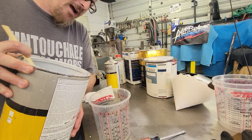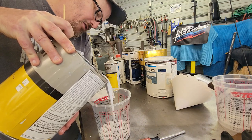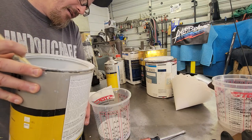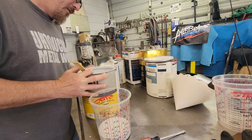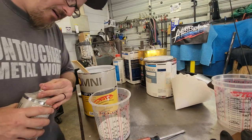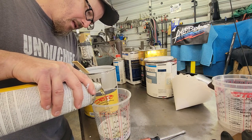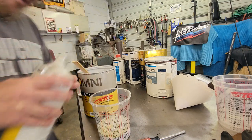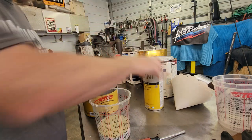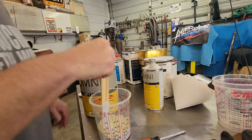We're gonna do the 3-to-3-to-3. I want to make sure I have enough, so I'm gonna fill the first one. No, let's do 2. Okay, I'll make my mind up a little bit. I just don't like a lot of waste. There's the 2. Wipe this off. Hardener, we'll take the hardener up to the next 2. And we'll try that. I don't add any reducer on this because this epoxy is already pretty thin. So mix that real good. Get her put in the cup.